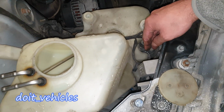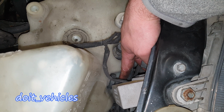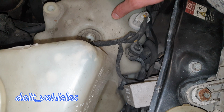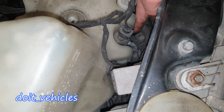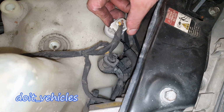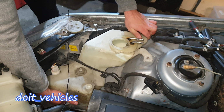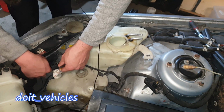And if you have a look on the side here, you can see the fluid level sensor, which is way above the existing fluid level right now. That means the fluid is not leaking through this point. Then we've got the pump which delivers the fluid to the main windshield. And then we've got the pump for the headlights. All you have to do is to pull the reservoir. Okay, this one is out.